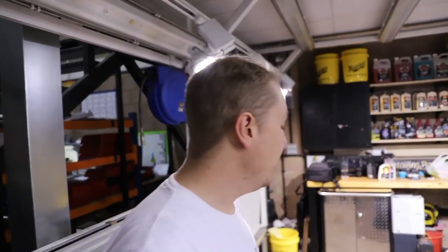So far we've gone around with the ultimate compound to remove those scratches and swirls. We've prepped the surface — we're going to detail it down after lunch and then get some wax on. We're going to use the ultimate wax because it's a metallic car — it's a synthetic wax, it's really going to boost that metallic and the fleck in the paint and give it a real deep gloss and solid protection for winter. Because it's such a light colour and we've used a soft pad with the ultimate compound, we've already refined it as we've done it. So we can go straight in with the wax, which contains a lot of polish, giving it gloss and protection.